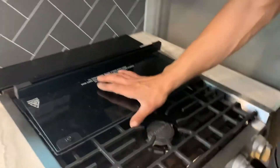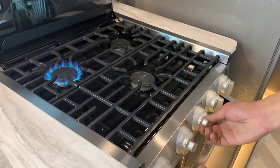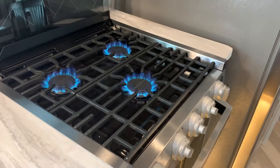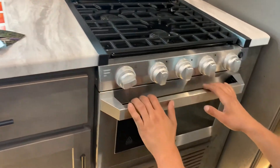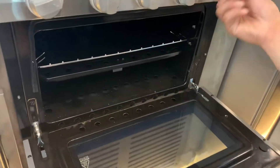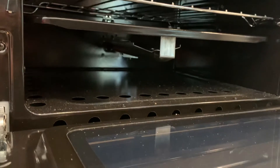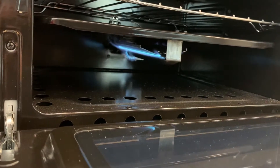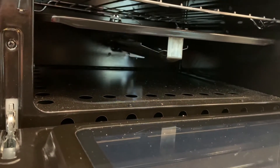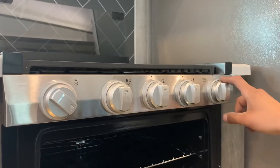For your stove, it's just got the bi-fold cover — just flip that back, turn the knobs over to the little flame and hit the sparker and she fires right up. The first time using it after a while where you haven't been camping, it may take a little second to clear out the air from the system before it fires up, but it will fire up. To use the stove: open it up, turn it over to the little flame, hit the sparker and there she goes. Hold that knob in for another couple seconds and then you can release it — it'll hold itself. Then you can select your temperature and she'll come up to that temperature for you. Once you're done, bring it back down to the pilot and it'll hold the pilot light for you. However, if you're leaving the trailer for a while or going traveling, you want to make sure it's right off.